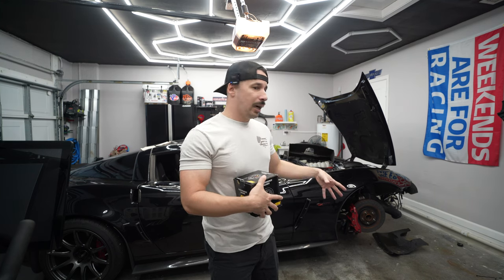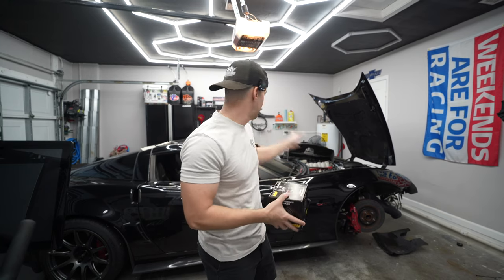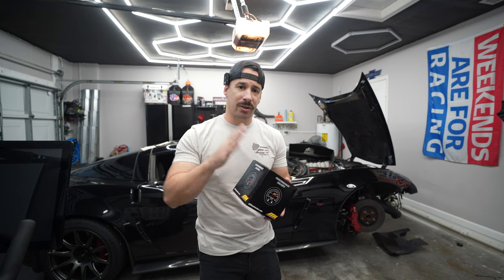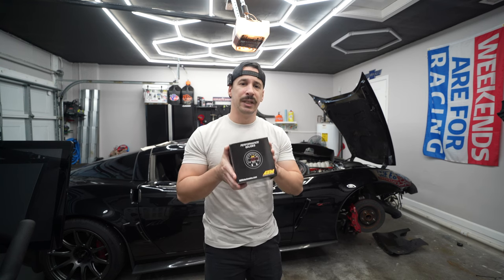While it's down, I've had this wideband kind of just sitting on my counter for some time. We're basically installing the wideband to get a better understanding of the air-fuel ratios, not only while I'm on track but while I'm under some heavy driving conditions — because we still do have a couple little concerns about whether it's running rich. This will give us that information.